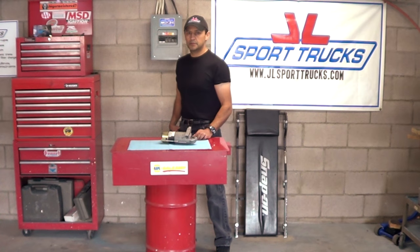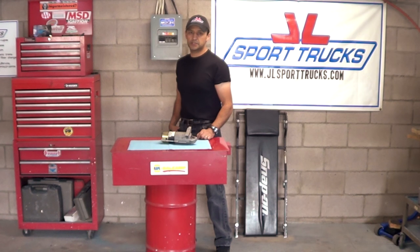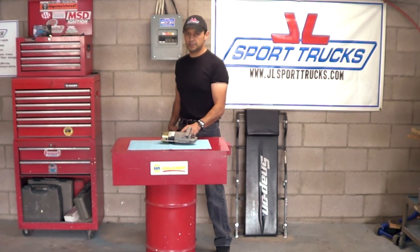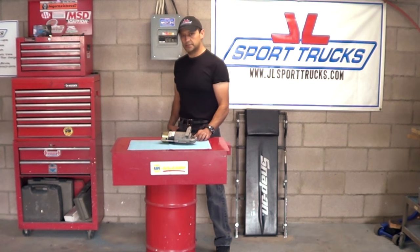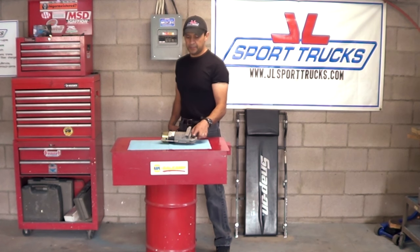Welcome to HowStuff and Macabre's channel. During the previous video, I replaced this starter on the 93 Pontiac Firebird Trans Am. Just by judging by sound, it appeared that the gears inside the starter were stripped. I'm going to take it apart to find out if my suspicion was correct, which more likely it will be, especially since every time I was trying to start the car, the Bendix gear would engage with the teeth of the flywheel but was not able to turn the engine and there was a grinding noise coming out of the starter.